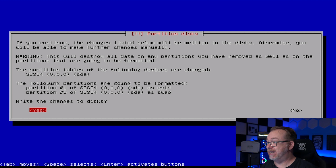The first thing we want to do is make sure that we have all of our drives attached. So we're going to come over here to Storage and go to Disks to see what's available. On here we have a 32 gig eMMC device that's onboard. We've also got a 447 gig drive — that's the 480 gig SSD from Kioxia that the folks over at ZimaBoard sent over. I'm going to use the SDA drive as our media or file storage, and SDB as our operating system. I'm not going to use the 32 gig eMMC — it just doesn't make sense for what I'm doing here.